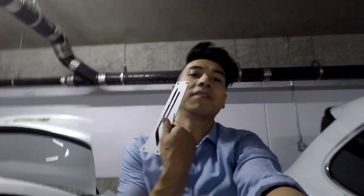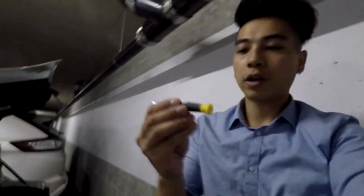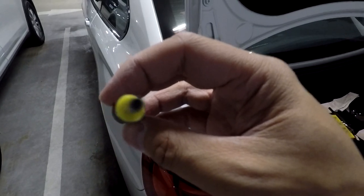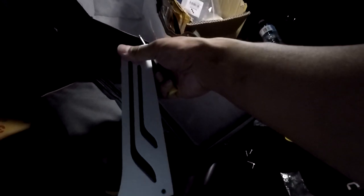The only thing left to do is install the last pedal, but it's too dark and I'm out of time. I need to get a proper allen key for these little screws because I currently don't have one, and I'm not able to install the gas pedal without it. I just got to my underground parking and decided to finish the job tonight. The screwdriver I needed is an H2.5 by 25 screwdriver — it has a hex or six-sided tip, and that was enough to fit these little screws.